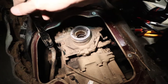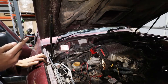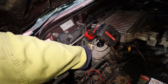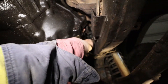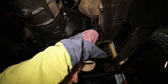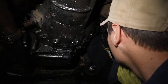After thinking about it, the four-wheel drive selector is short enough that it shouldn't need to come off — it shouldn't interfere with anything when dropping the gearbox. Now for the starter motor: it's a bit tricky. Crack the top nut with a spanner first, then come underneath with a quarter-inch drive ratchet using a wobbly extension because it's a very tight squeeze.